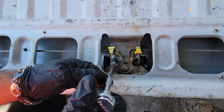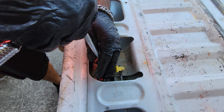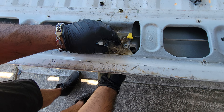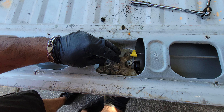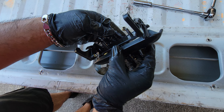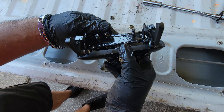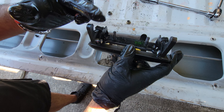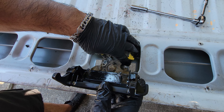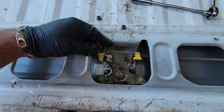A 10 millimeter socket is what you need for these two screws — go ahead and take them off. Once you remove these two screws, you pull up this little piece and undo the little levers at the bottom, and that releases your handle. I already installed mine, but I want to show you how everything went. These two little levers are the ones that push down on the mechanism.